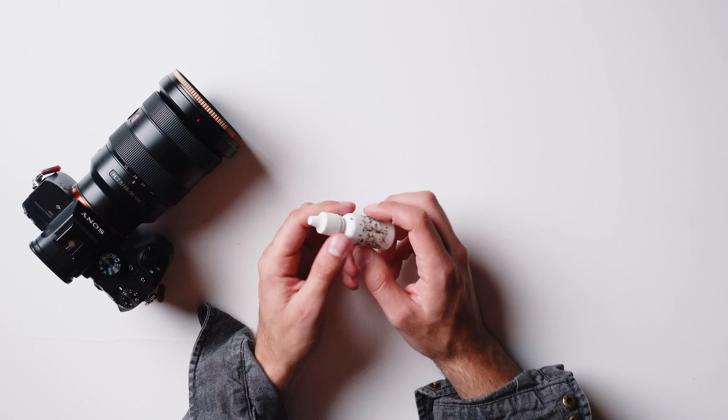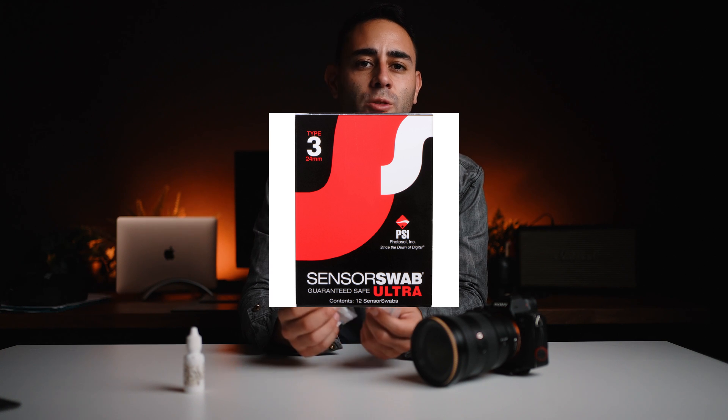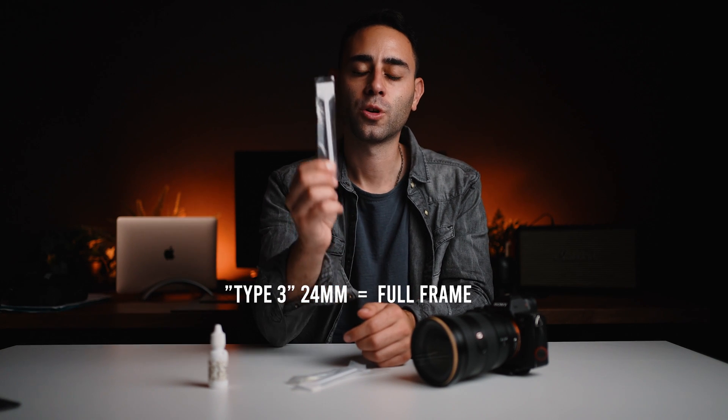Assuming you used your blower and you've still got pesky dust on the sensor, we're going to move to this solution. I also use this to clean my lenses, but it's great for cleaning sensors as well. The next thing you're going to need are these little swab sticks. You can buy these in boxes — I think it's like 10 or 20 in a box. I'll also keep a few of these in my bag for emergency cases. These two things are the key to keeping your sensor super clean. This size is specific to a full frame camera — it's exactly the width of the sensor. If you have an APS-C size sensor, they make smaller sizes, so you just want to buy the correct size for your camera. I'll link these in the description below.